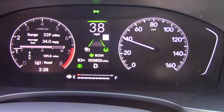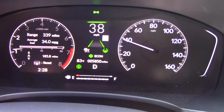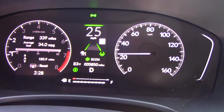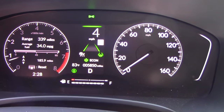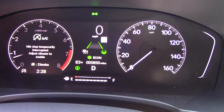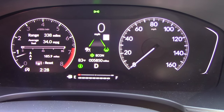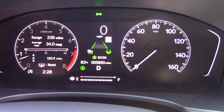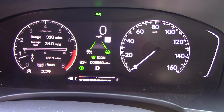All right, we're out on the road. I don't have the adaptive cruise control active but the lane keep assist is on. You can see those two green lines between the speedometer and the tachometer — that means it's reading the lane lines and able to control the steering. The lane keep assist logo itself is green, so that's how you know the function is working. It won't be active unless the car's camera can read the lane lines and be confident in the information it's getting.